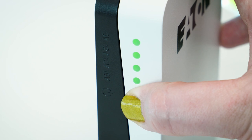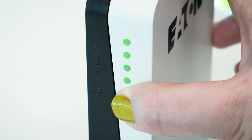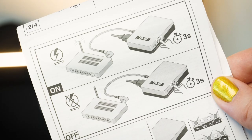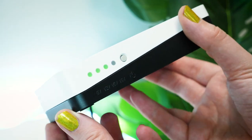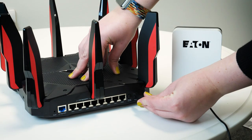The flashing light system also helps distinguish when the battery is running low, as well as indicating when the voltage changeover mode has been activated. It's crucial to note that you must check your device to ensure it matches the correct power input, and it's worth making sure it's disconnected from the device before altering the voltage to avoid a power surge. The battery indication scale is bright, moving down the scale to show battery drain in increments of 25%, with a rapid flashing light when the battery is low. It's simple and easy to control with no complicated menus.